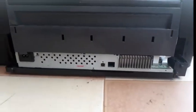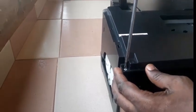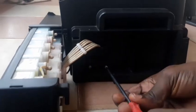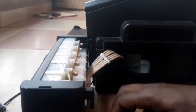Once you have done that, you have access to remove the side panels one after the other. On each side panel there are about two screws, one up and one down. Unscrew them. Then for the ink tank area, there are two screws to remove — lift it out and gently remove those screws. What you are trying to do is to quietly remove the casing from the body of the printer. Once you have done that, you will be able to remove the side panel on the other side as well, and it should come out without any resistance.